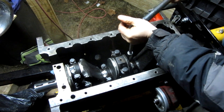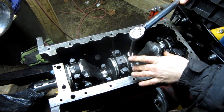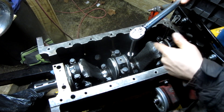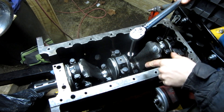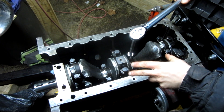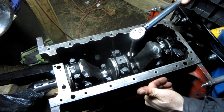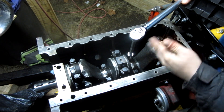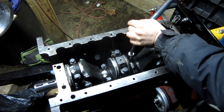The reason I haven't spun this yet — when I first had this crank installed, I thought let's just spin it and see what happens. Before I had torqued it all down, two out of the four piston bearings turned inside of there. I'm not going to do that this time. I know it turns, I know there's nothing wrong with it, so I'm just torquing it down and whatever happens, happens.